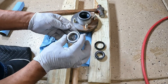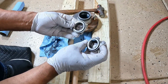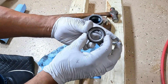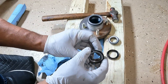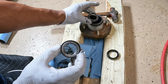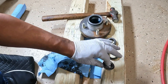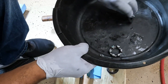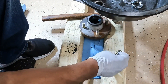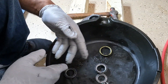I'm actually looking at the bearing numbers to make sure they're the same size - L44649, L44649, and that's a fit 195, fit 195. So these bearings are the same size, so it doesn't matter if you put one in the front and one on the back side or switch them out - they're still the same. We're going to be cleaning these up with some kerosene. I'm going to take my washer, my castle nut, my cotter pin, my bearings, and also the seal - put them in a pan and pour some kerosene to clean everything up.